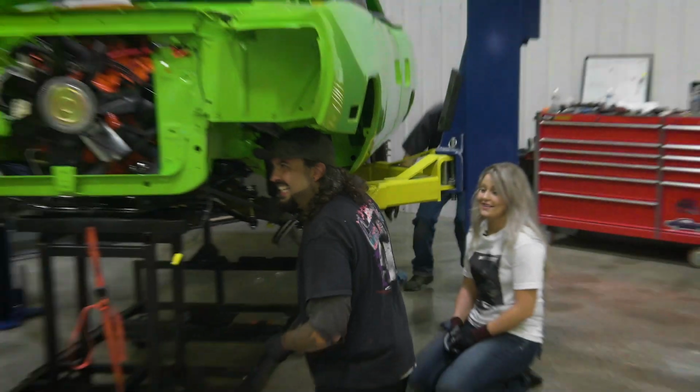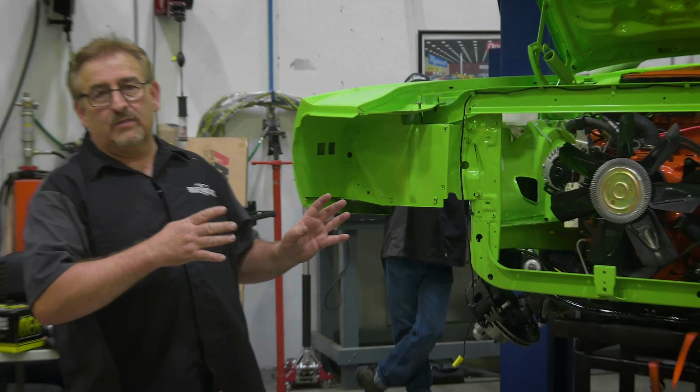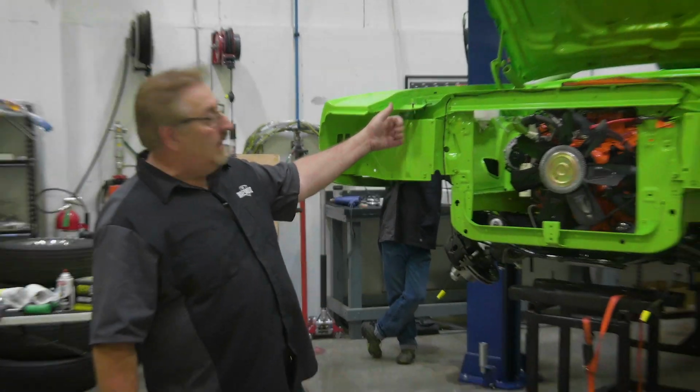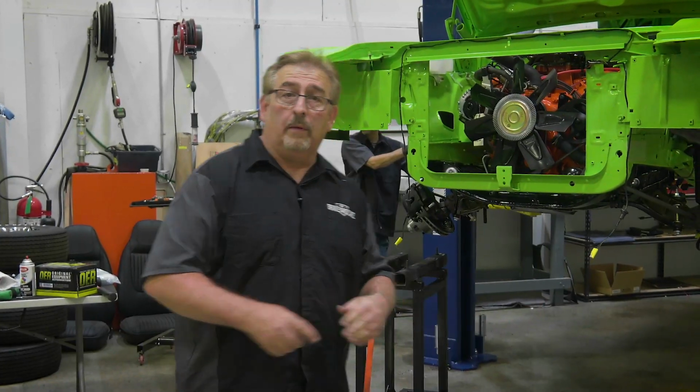All right. What's up, Mayor? All right, Dan, go up, bud. So we've got go ahead. All 4 K-member bolts in and 2 cross-member bolts for the transmission. So right now, Dave's just raising it up in the air. Then we can go in, tighten down the K-member and the cross-member and start plumbing out the rest of the bottom of the car.